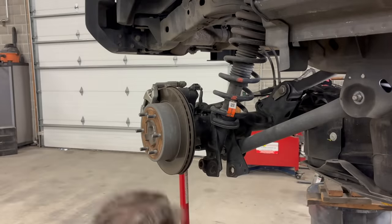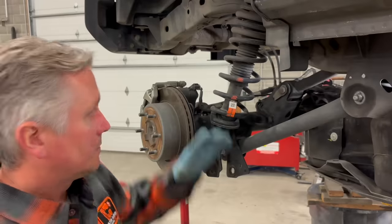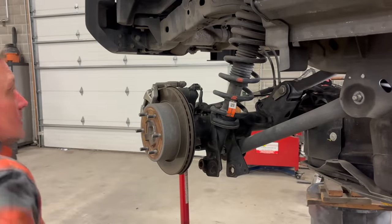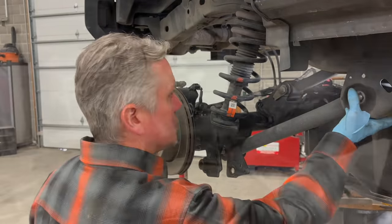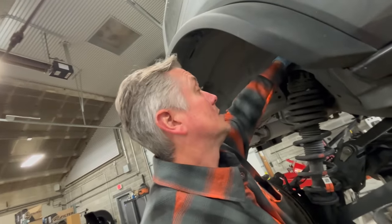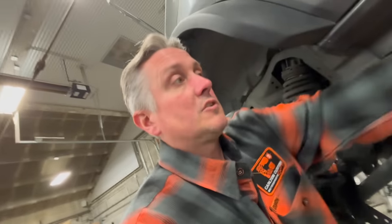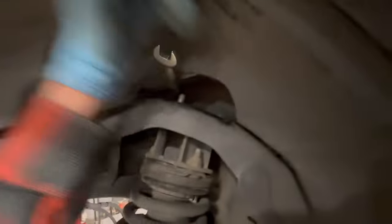That rear shock wasn't really under up-and-down pressure — it was more like it was being twisted so hard from full droop and being pulled forward. We'll get that out of the way and then start with the new shocks. I'll button up this whole side all in one shot. Don't tell anybody, but I kind of cheated and cut some plastic out of the way. The flex-head ratchet wrenches are so good — if you're going to buy one set of ratchet wrenches, always get the flex head. I got fixed ones on my Blue-Point set years ago and I always wish I'd bought the flex ones.